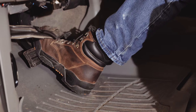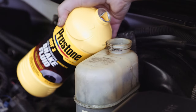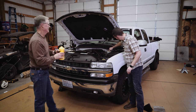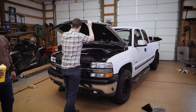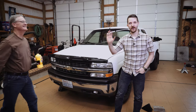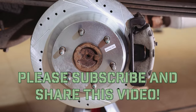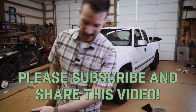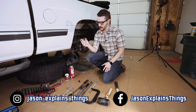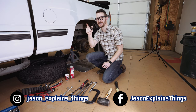Our rear brake is almost done. Torque your caliper mounting guide pins to 31 foot-pounds. Last thing to do is pump your brakes until your pedal is firm — all you're doing is pushing those pistons back out at all four wheels. And you're done! We've changed the brakes on the truck. Thanks for watching — changing brakes on your Silverado is easy.